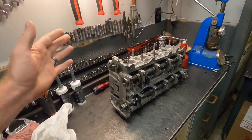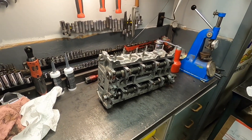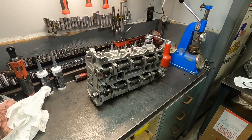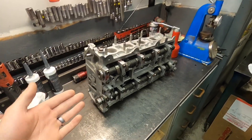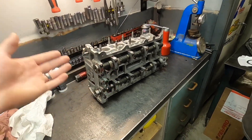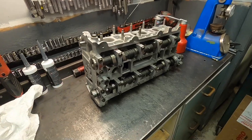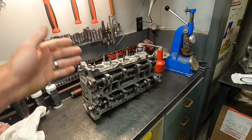This is really important information, especially if you're trying to learn about your engine, DIY stuff if you have the tools, or just want to know what to expect when work is getting done. One thing I asked was: after the valve lash is set, am I able to pull the cams off to put the head studs through? He said yes - once they're set, you can lay the cams back on, torque them down as you would, and be set to go.